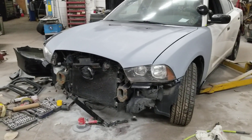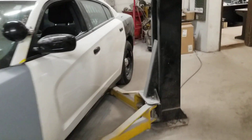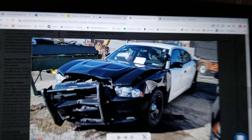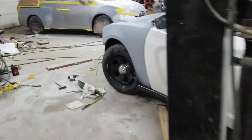So far I put a used fender on it. That hood is the original hood. I did a quick video on it the other day - this hood and this car is aluminum. Let me tell you, never again will I attempt to fix an aluminum hood. Here's a picture of the car when I bought it - that hood is trashed. But I straightened it out, and the thing is the aluminum rips. The stuff is so tinny, it's honestly like working on a pop can. This stuff is just terrible.